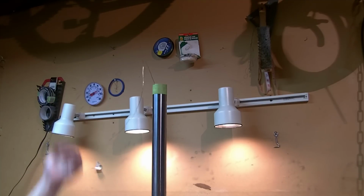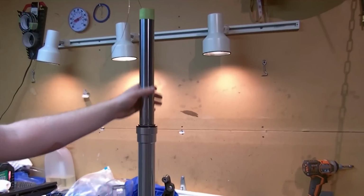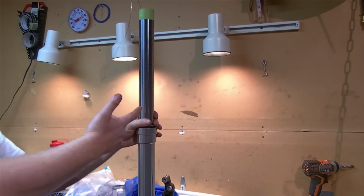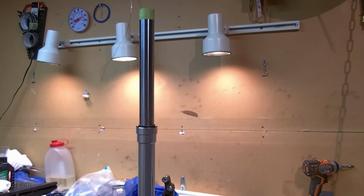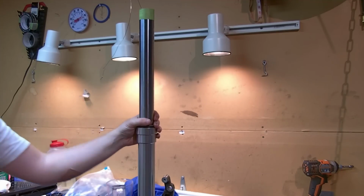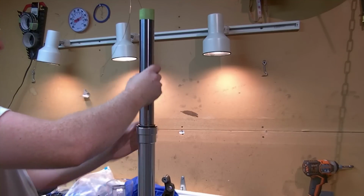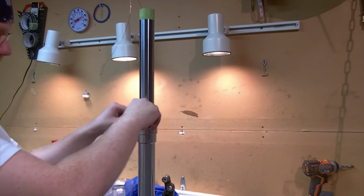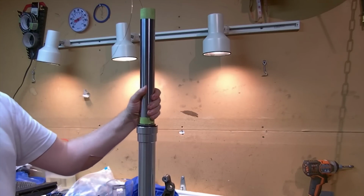We're going to leave our wire attached because we're going to need to pull that rod up again. We have to attach the cap. And at this point then we stroke the inner tube. We're not supposed to exceed the full travel of this bike, which is about 5.31 inches. So we're only going to go maybe 5 inches in stroke. And we're going to do this, say 10 times. And we'll pull up on this. And for reference of height, I think we'll just put a piece of tape here, and that way we can see our start and stop points better.